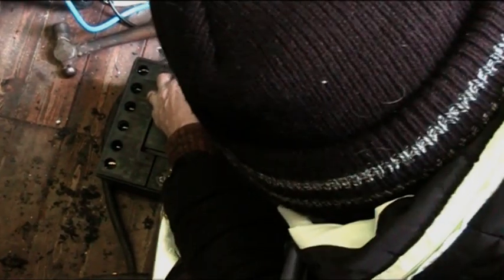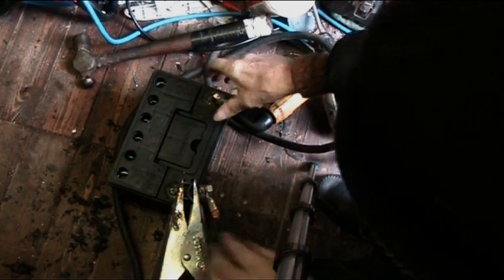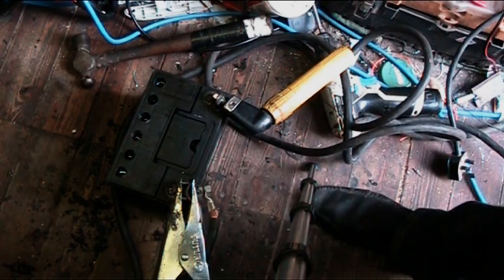Now you want to charge it for about 3 minutes. A lot of them said 5 minutes, but in this particular case, as this battery is not that bad, I think 3 minutes is more than enough. I don't want to damage the battery unnecessarily or cook it. Make sure that's done up really nice and tight. Put it into your gun and do it up nice and tight, like you would if you were putting a stick in, so it's got to be a good fit. Make sure your earth is on there as a good fit.